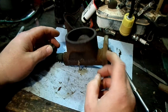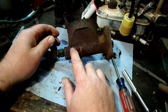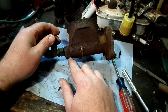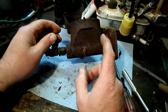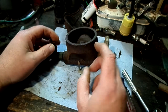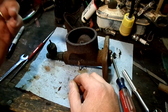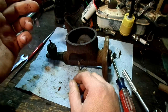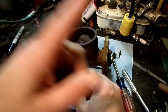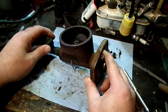In all those instances there are two pistons inside, so one's feeding the rear brakes — usually it's the front piston that does the rear brakes and the rear piston does the front brakes. With the exception of some oddball cars like Volvo, what they did is one reservoir did the left front brake and the right rear brake, and the other reservoir did the right front and left rear, so they crisscrossed the patterns. There are a few of those out there but that's not typical.